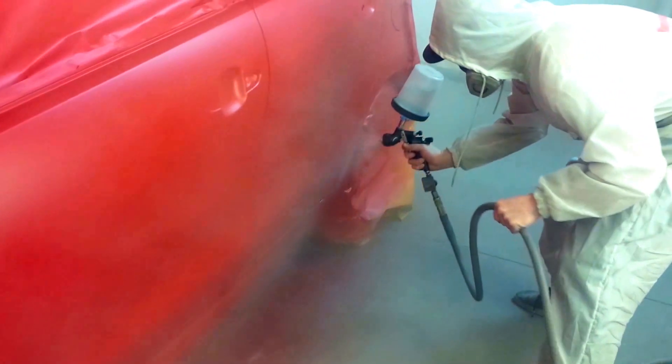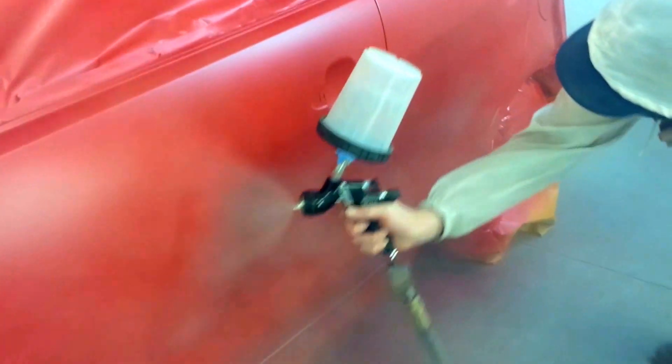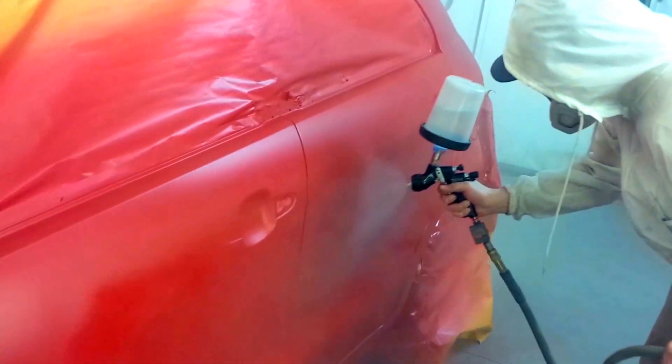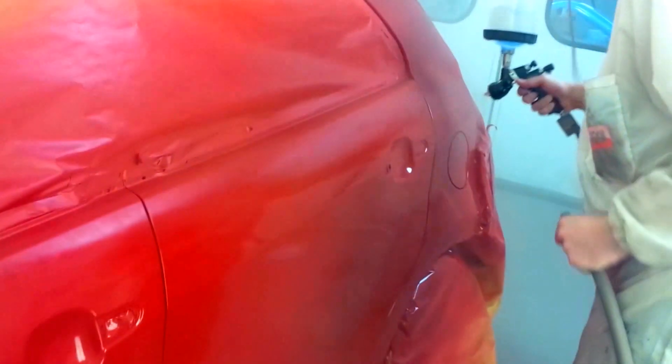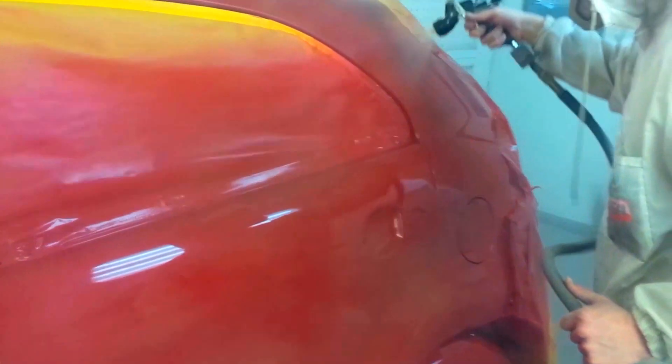Getting back to the clear job — I like to walk the entire length of the job on something like this, and I don't think he's rolling his wrist as well as he should be. It looks more like a dead stop halfway through the door, and you're going to get a material build-up there. I've gone through so many DeVilbiss regulator gauges too — the one on the bottom of the gun. I don't know why I don't like those gauges, but I do like the gun. You also go through a lot of baffles on them. Some people say they've been using it for years with no baffle problems; other people say they hate replacing the baffles every month.